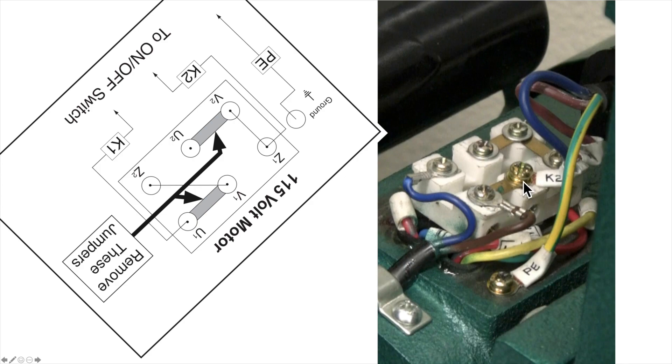The capacitor — I wasn't running the capacitor the right way in 230 mode either. This one didn't trip the breaker when it smoked out. All the smoke was coming up out of the hole at the bottom, and it probably smoked for about five or six seconds before I caught it and shut it off. When I called Grizzly, the warranty department was really good about it. I told them I had converted over to 230 volt and moved the jumper — they weren't concerned about it at all. We thought it was a bad motor. First we thought maybe some oil had leaked down in there and that was what was smoking. They asked me to turn it on again, more puffs of smoke, a little flame shot out — confirmed it was a bad motor. They sent me a new one under warranty, and everybody just thought I got a dead-on-arrival, bad motor.